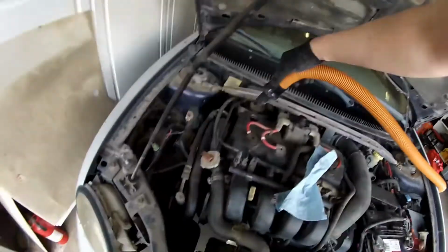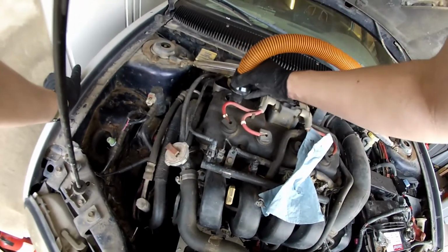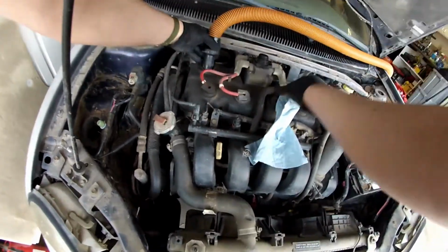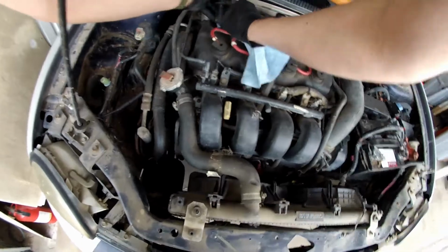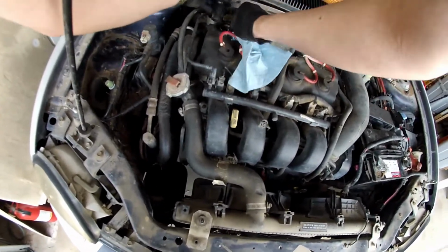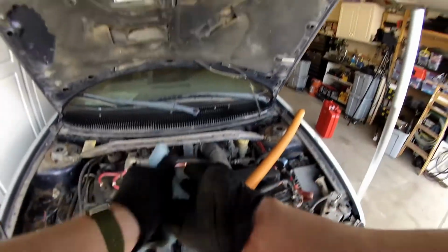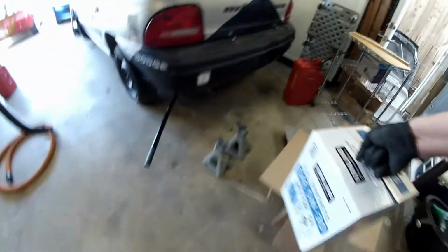A remote setup for air and vacuum is pretty easy with a set of Wi-Fi outlet plugs these days. I have a 3-inch PVC pipe that runs up into the attic, and I routed that and compressed air to the center of the garage. The shop vac and compressor live in a sound deadened cabinet. This is very handy and highly recommended. This is not an ad for Costco.